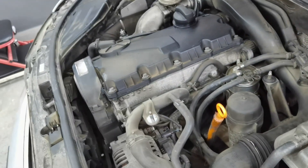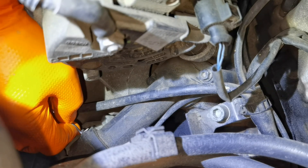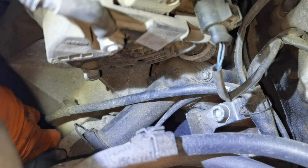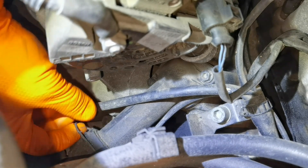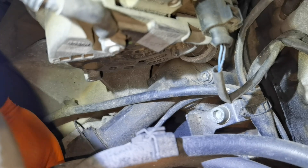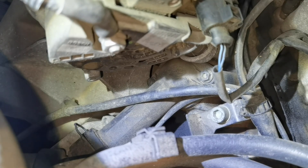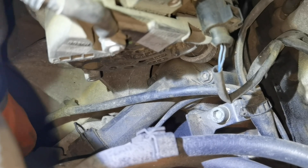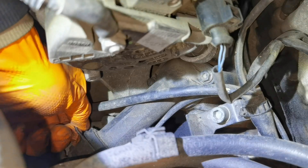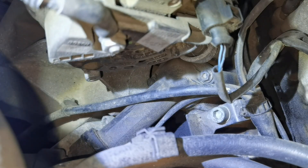Because of that I decided to leave the hose on the engine and only remove the two screws which are securing the pipe mounted over the thermostat. I recommend that if the hose is not coming out — as in my case — don't bother removing it at all, because in some cases the plastic part can break and you don't want that if it's in good condition. You can just leave the hose attached to the thermostat housing and go ahead and remove the two screws securing it to the engine.